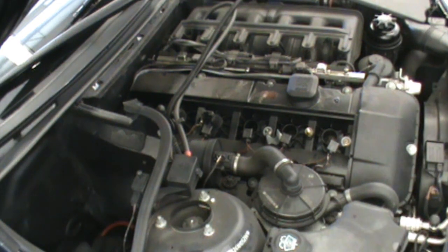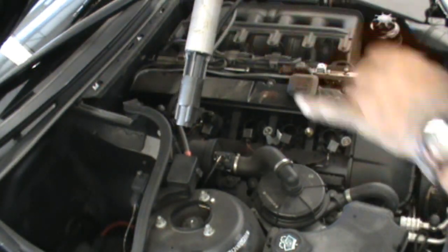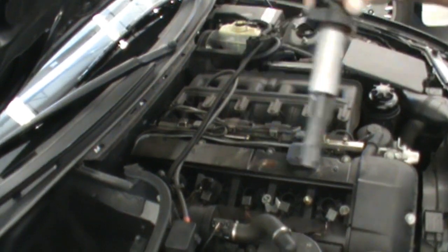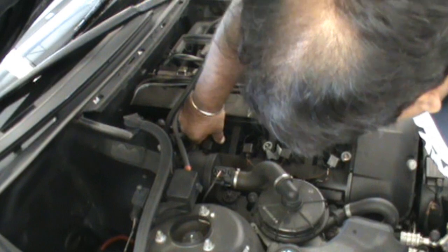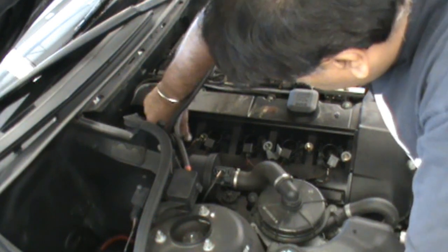As you can tell here, and you can see on this one, we have an oil leak. And you've got oil on the inside of the plug, right up there up top. And as you can tell, we did not actually pull the valve cover off yet. That was just the plastic piece, the dressing that goes on top of the engine here.